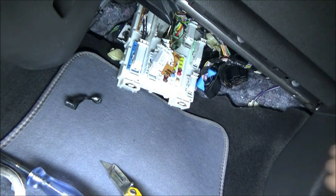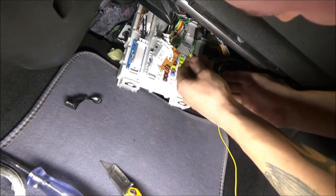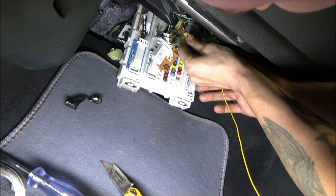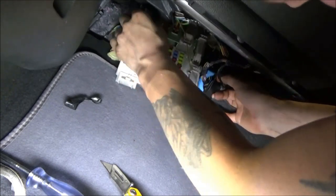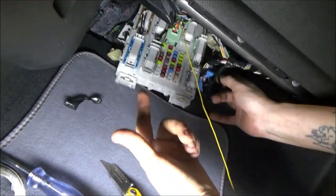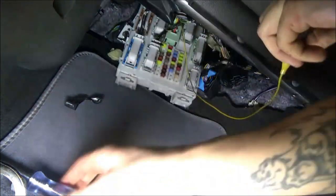So what I'm going to do is I'm going to put a clamp fitting there, or, you know, a little alligator clip. Just, you know what? I'm just going to use a jumper wire. And what I can do is I can run that jumper wire down to my test light. And then I can see if we have power here in the lock position. So it's got this little jumper wire. Hook the jaws of it around there. Now, an issue with doing this is that, you know, obviously this module is providing power on this wire. So if that bare wire were to touch ground, it's going to fry the driver in this module, and that's no good.